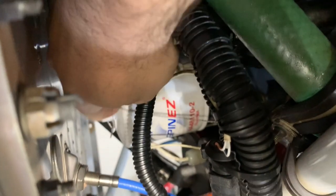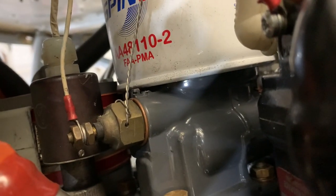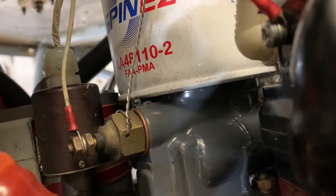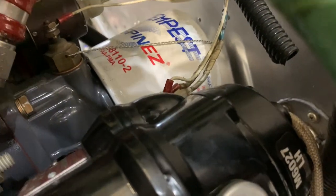So first of all, the safety wire isn't very tight at all. And then what's interesting is that when you look at the old temp sensor and the direction the safety wire is pulling it, that is pulling it in the loosening direction. So not the worst one we've seen, but I'm going to start recording them just for posterity's sake.